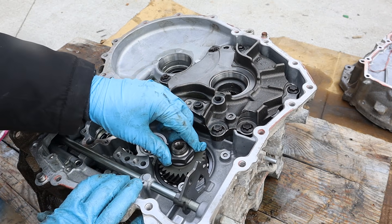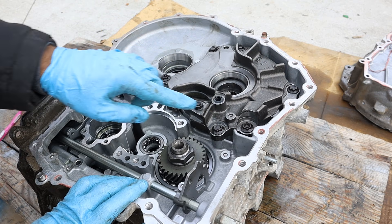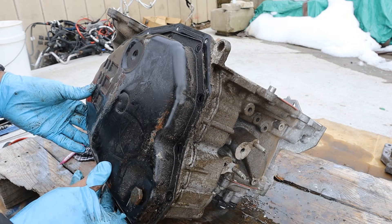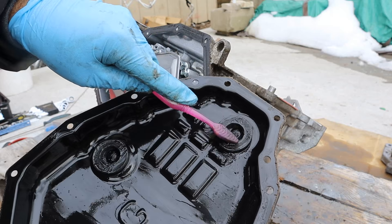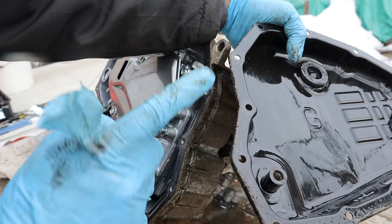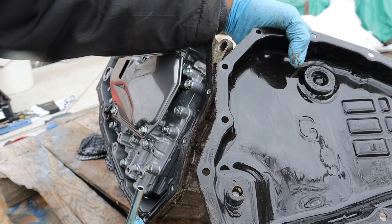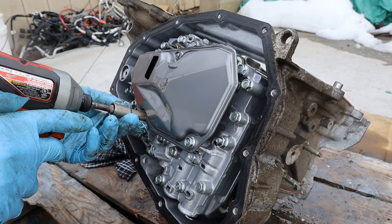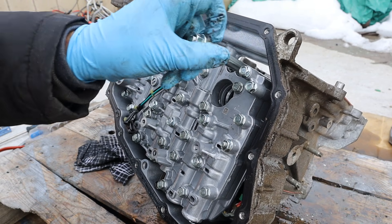That's as much as I can get from the top here — this has a giant socket on it which I probably don't have the size for, and these have a weird spline shape. I'm going to work on removing the transmission pan next. This is what it looks like inside of a CVT with 2,000 kilometers on it — there's always going to be some debris left from manufacturing. This straw threads into here and provides the optimal height for where fluid is to be filled to. You pull it out and excess fluid will drip out at the correct temperature. There's no real dipstick on this, and here we have the valve body with the filter in front of it.